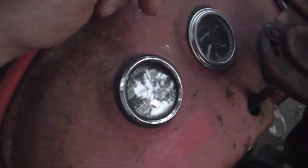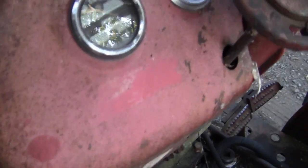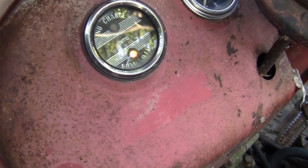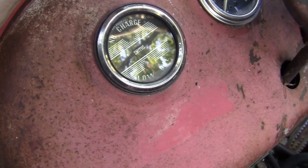I need to put the oil gauge on it, but that's not going to happen tonight — looks like we're going to get rain. The dreaded flickering oil light: if I go any lower than 700–800 RPM, and as it gets warmer it gets worse. If I idle up, it goes away — until it gets really hot and then it stays on.